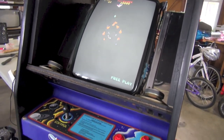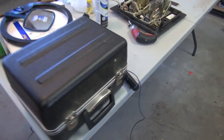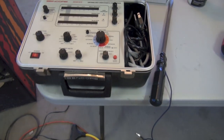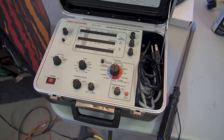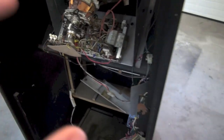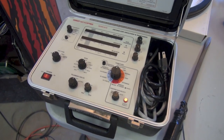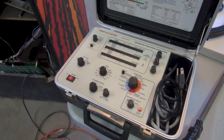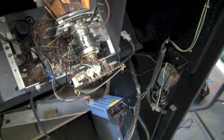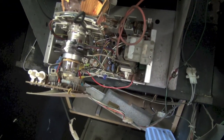The other thing is I feel like the guns might be a little bit weak. What we're going to do is hook the monitor up to my Sencore CR7000 restorer analyzer. This is a great piece of test equipment that can also fix the problems it finds. You want to use this device if your tube is dim, if the controls don't cooperate, if you can't get the colors to adjust, or if the picture is very dim — all good indications that the tube is tired and the guns have issues.